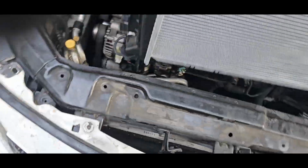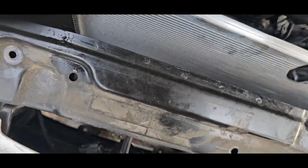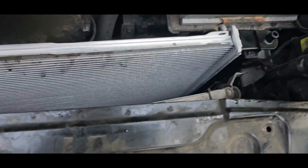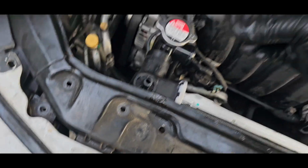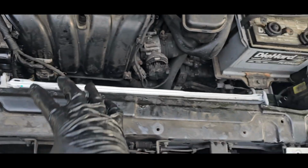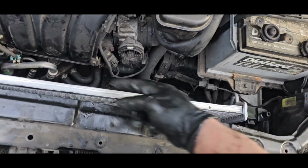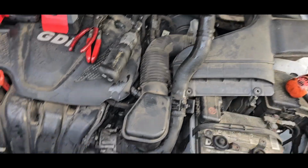And you stick this back in. And then you gonna take that condenser, lift it up, drop it down right on top of them clips. Gotta lock it in. And then you take these right here, you gotta transfer them, put them back on both sides, and then slide it back in. And then put your 2 tins in there. Gotta hold it in place. Then put all your hoses back on, starting at the bottom, work your way up. And then you can put your fan in, and then put that in, and then you're done.